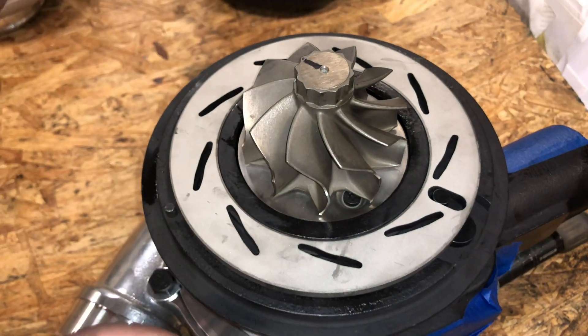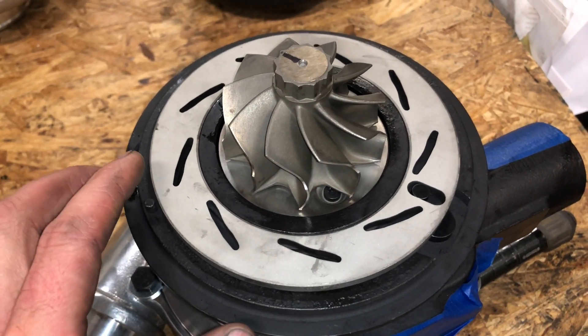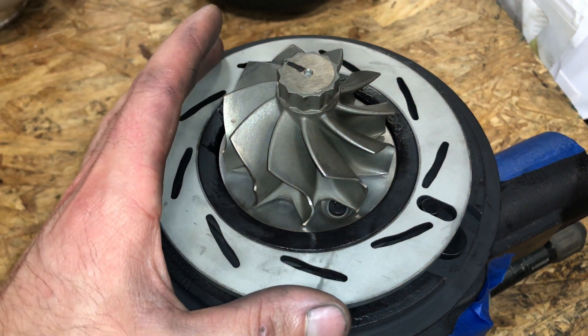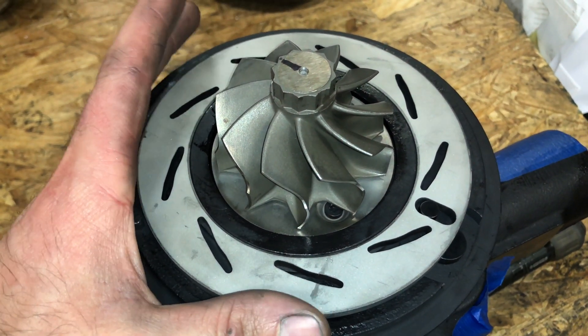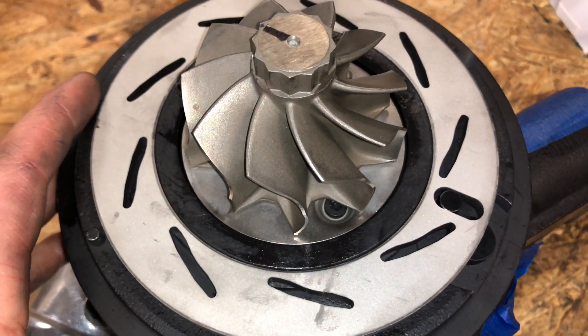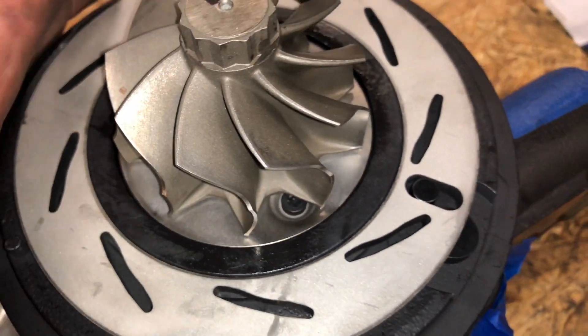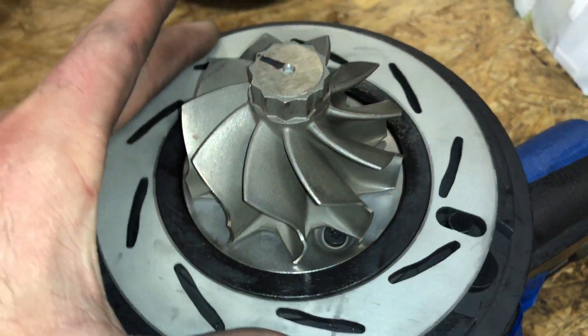I just always go and paint it — one coat of paint on it. If you start to paint too thick, the clearance will be too tight and it will cause it to lock up that way. So I go kind of minimal with the paint. But you can see how much play it's got there, so it's got room to move and it should operate just like that.